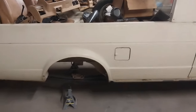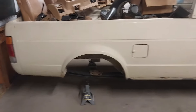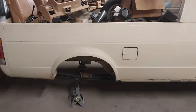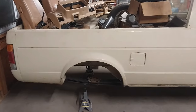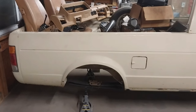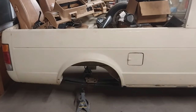I can put my charger back there. I'm going to have a 10-kilowatt Tesla Model S charger — it's a giant charger, it's a lot of power. Actually it's more power than I would ever charge this thing at home. My off-grid inverter is only 12 kilowatts, so if I had that thing charging at full speed, it'd get filled up fast, but I wouldn't be able to do much else with the inverter — especially if it was powering the house. But if the inverter was just powering the garage, I could totally do that. For example, if it takes 10 kilowatt-hours to get to work and back, I can just plug it in for an hour and it'll be full. That is pretty fast charging for not DC fast charging.